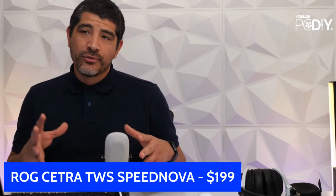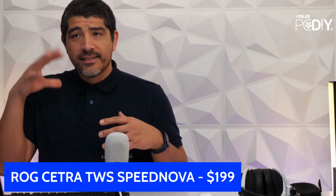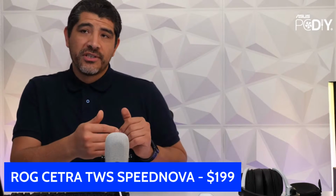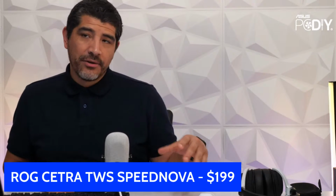One, it gives us ultra low latency. So it's going to really be able to give you that sub 1 millisecond gaming grade latency, really good encoding efficiency and stability, and consistent performance, whether you're further away or close to the device, along with really, really good power efficiency. So when we talk about our keyboard or our mouse or these devices, when we say SpeedNOVA, it's because the SpeedNOVA is actually the chipset that is helping to facilitate a lot of the wireless-based performance for the product, right?